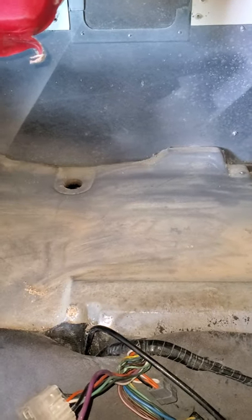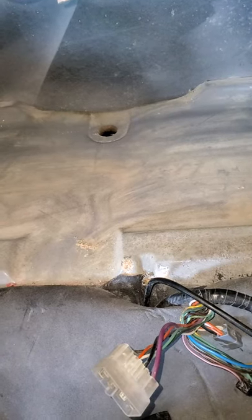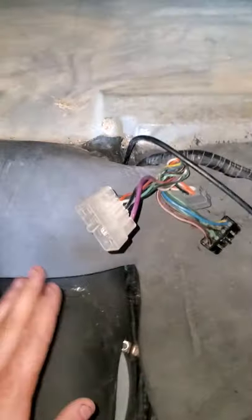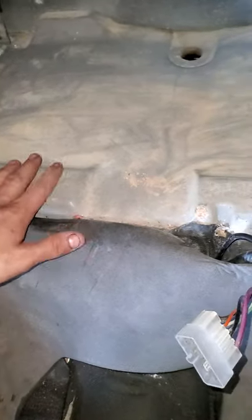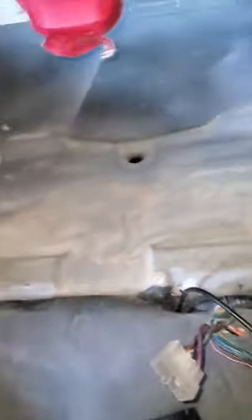One more thing I noticed: even after taking the plug out and draining it, when I tried to pull the tank out it still had a little bit of gas in it — maybe from it swaying left to right. It's going to try to spill on your floor through these cavities. What I did was take shop paper towels and stuck some in this cavity, this cavity, and this cavity. When I pulled the tank out, I let it rest on those for a second to catch the last bit of gas. Then you're able to take it out through either the driver's door or the passenger's door. That's how it's done — thanks for watching.